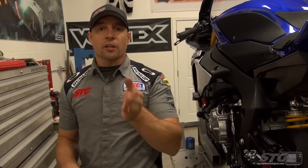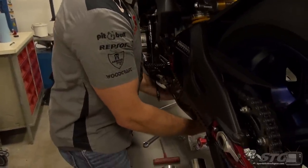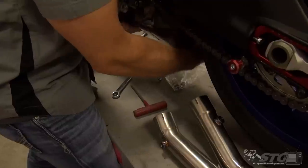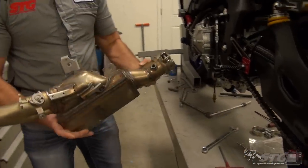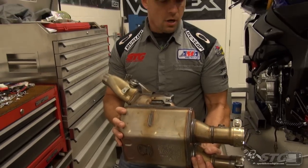If you haven't already eliminated your servo, you're going to have to deal with the cables on the other side — it's a really basic, super simple thing. Once again, we have a video where I've done all that; you can watch it and it'll walk you right through the process. Now for the muffler box — I'll support it underneath, wiggle and pull back. It does have some weight to it, so don't just let it go. And there you have it — we are ready for our install.